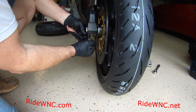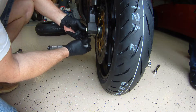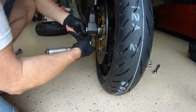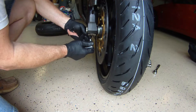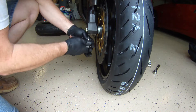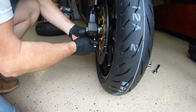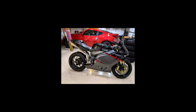A trick for the pinch bolts: always use an inch-pound torque wrench. The math is 15 times 12 — whatever that gives you is what you set on your inch-pound torque wrench. Because it's a smaller wrench, it doesn't let you apply as much force to the pinch bolts, saving them from stretching out. I'm sure whoever worked on this bike before has already stretched them, but there's a nice picture of the bike. Thanks for watching — if you like it, please give me a thumbs up.